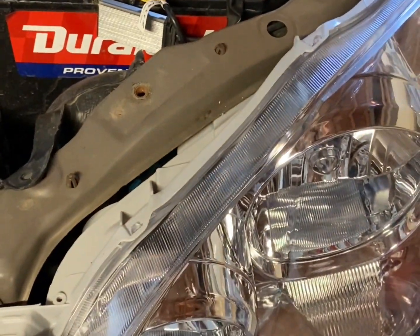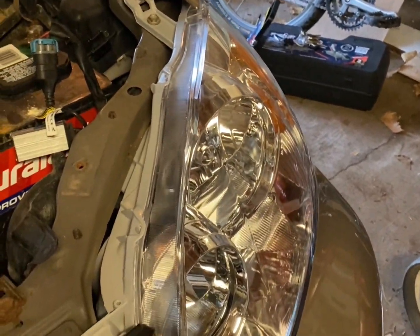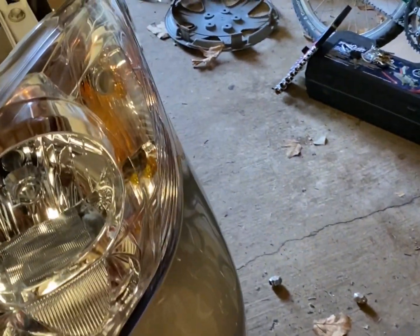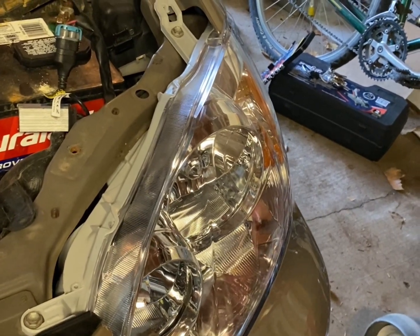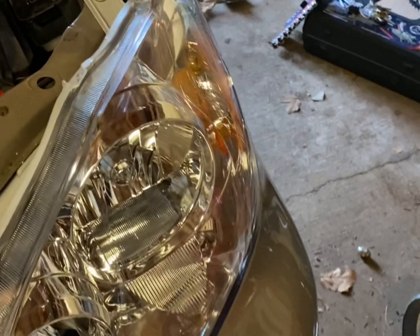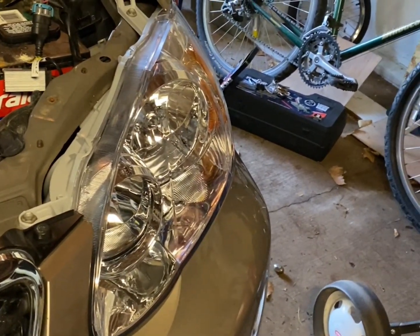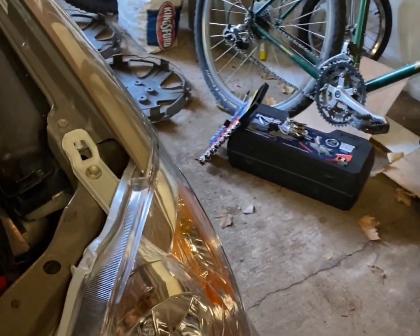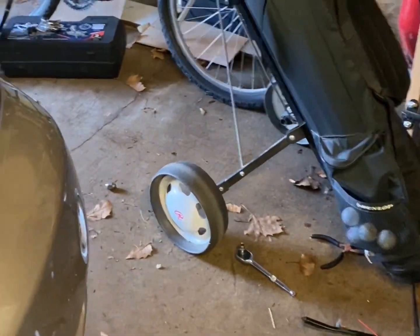There are three lights in the back of the assembly: high beam, low beam, and turn signal. I disconnected the cables for high and low beam — I have an LED conversion kit in here, which is why mine are super bright. Just note that with an LED conversion kit, if you plug the cables in backwards they simply won't work, so pay attention to polarity. The turn signal bulb is a screw-in type — just turn and it pops out. Be careful not to crack it. Once all those lights and bolts are out, the whole assembly comes right out. To install the new one, transfer your bulbs from the old assembly into the new one and reverse the process.